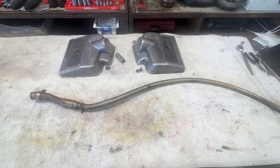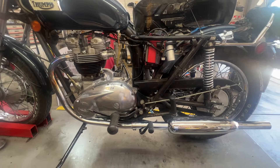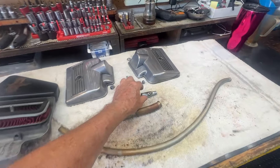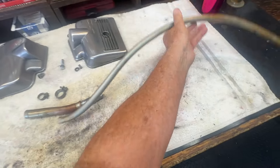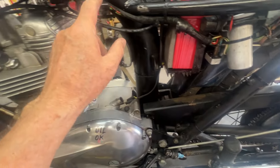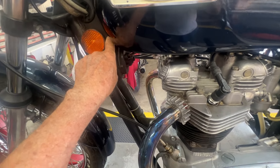Here's the whole breather tube — let's see if we can't clean it up some. I've got the full breather assembly and hose off. This little connector here, which converts this fitting to this, is broken. This pipe here used to have a tube that would come off and go all the way up to the front of the bike, following the frame, up to a fitting, to vent the oil back into the frame oil tank.